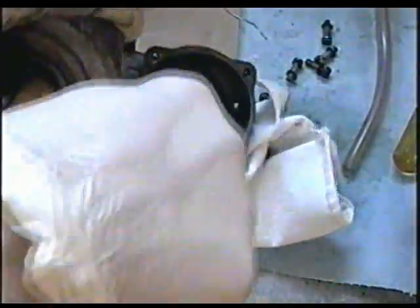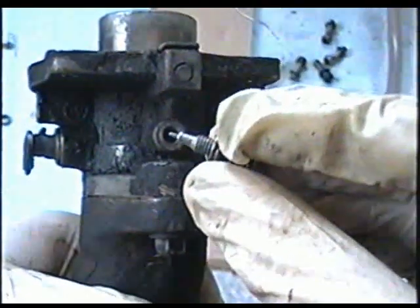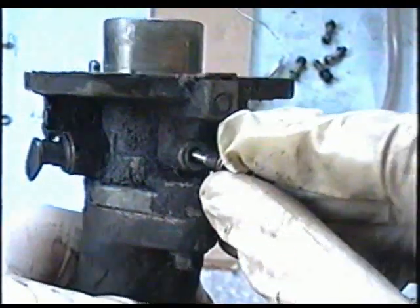When you're all done, air blow your carburetor with your air compressor. I've cleaned the screw that goes on top with the wire brush — it was out at three and a half turns, so be careful to remember your setting when reassembling.